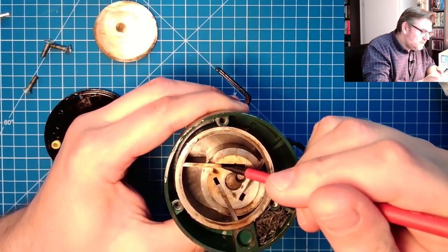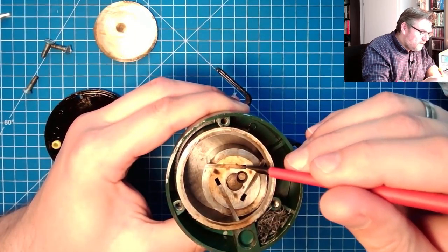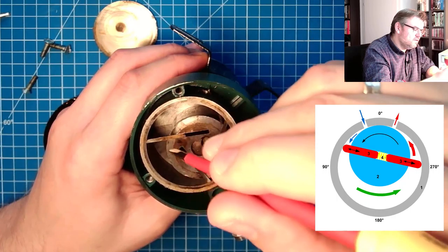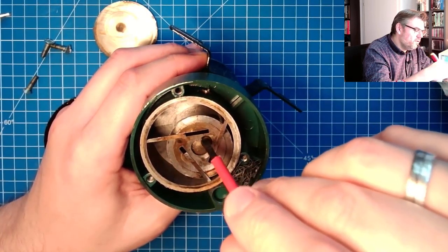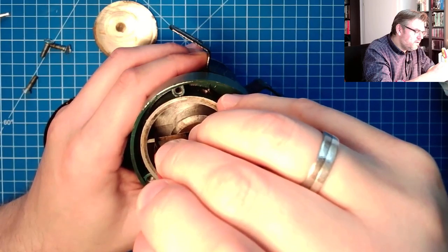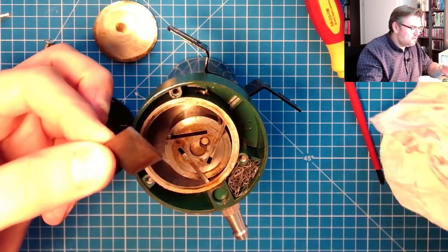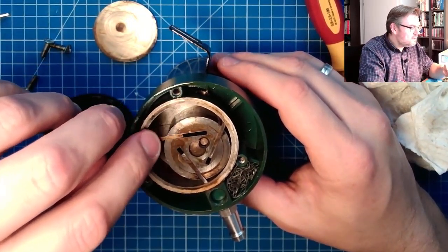You see this, this sticks a little bit. Maybe this is the issue. Those sliding vanes here. In the picture from Wikipedia we have shown you, there were little springs which moved this to the outside. Here there seems to be no spring inside. But look at the construction. Somebody found the possibility to get rid of the spring, because the spring, of course, is something which is... I can even take it out. Look at that. Okay. Nice. So this is this vane, and this is just sliding inside this. Just sliding there.